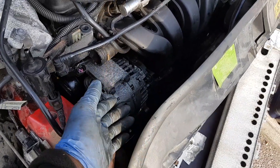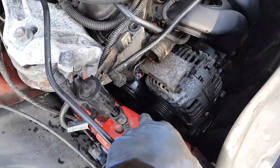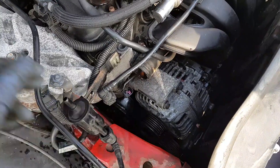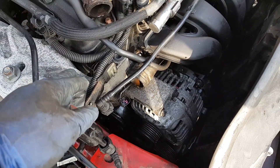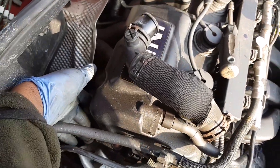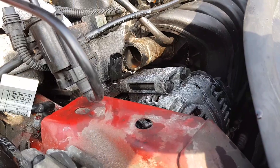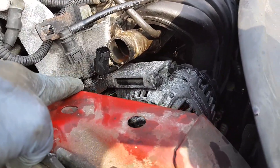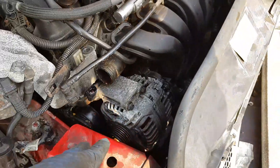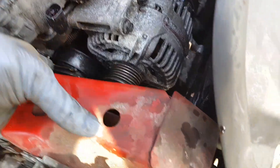This thing might also be in the way when removing the alternator. To get a ratchet onto the tensioner, you'll have to drop the engine down a bit. What I did was undo the engine mount bolt enough to drop the engine about an inch — you can see the gap here. Do all of them, but don't drop the engine completely, just enough so you can get to the tensioner. Once I did that, I moved the tensioner backwards.